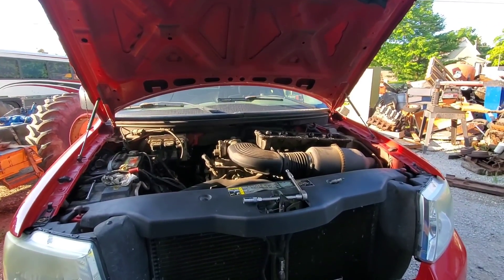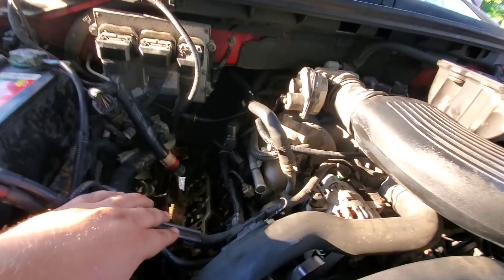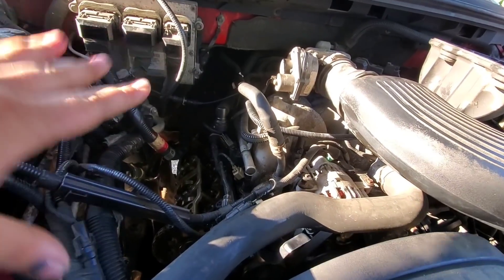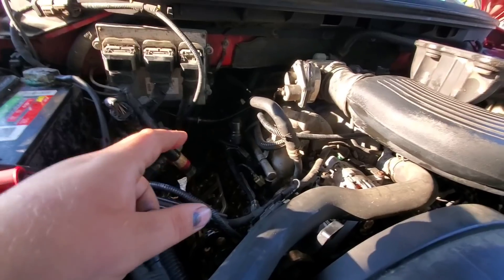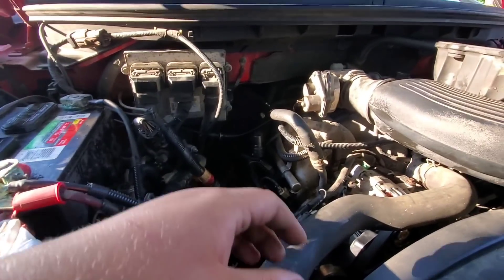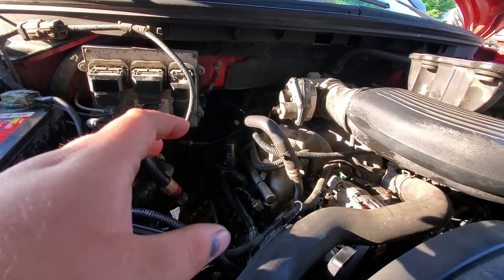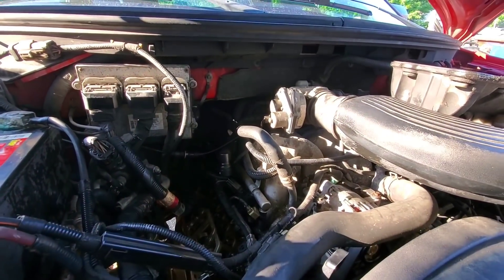So we tore this thing down yesterday to try to find a ticking noise I was hearing out of this bank of the engine. I've got it apart and other than a lot of timing chain slack, I can't find that ticking noise. They've had issues before — like three different times it's blown out the third spark plug back on this side. Now it's got a bunch of loose coil packs, the intake gaskets are leaking. This thing has issues. But I'm trying to diagnose this ticking noise before we go any further, because we need to find out what's wrong with it.